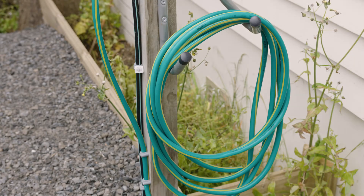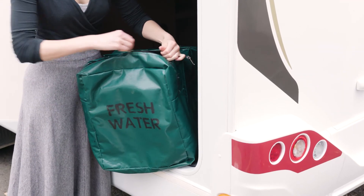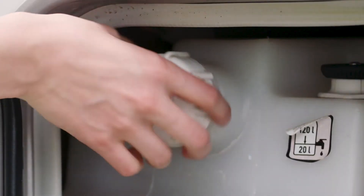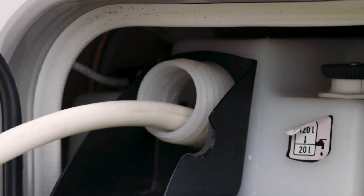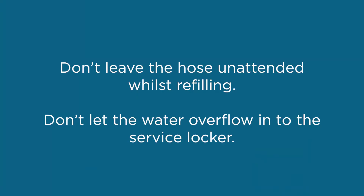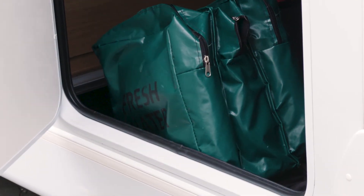There's usually a fresh water tap for refilling your fresh water tank, located a couple of metres away from the waste disposal drain. You must not refill your fresh water from the tap right beside the waste disposal drain at the dump station, as it may be contaminated. Find the fresh water hose in the bag. Don't use the hose supplied by the dump station. You'll find the water tank inlet inside the service locker. Remove the cap. Make sure to use the overflow chute provided. Place the hose inside the water tank and turn on the tap to start filling. When water overflows, the tank is full, so turn off the tap. Place the filler cap. Don't leave the hose unattended when you're refilling and don't let the water overflow into the service locker. Remove the hose and connector from the tap and put it back in the hose bag before stowing it.